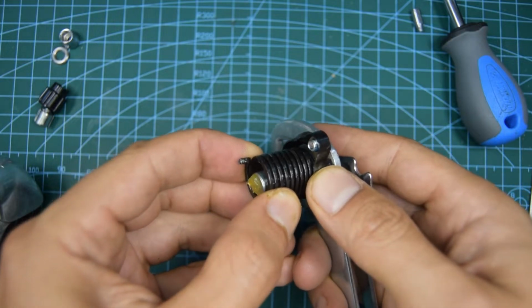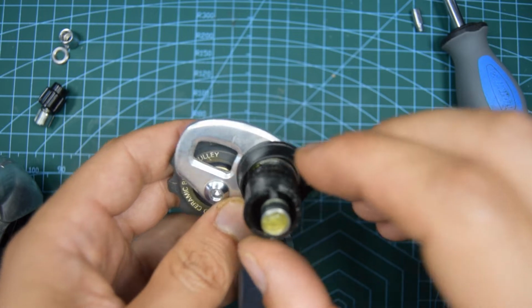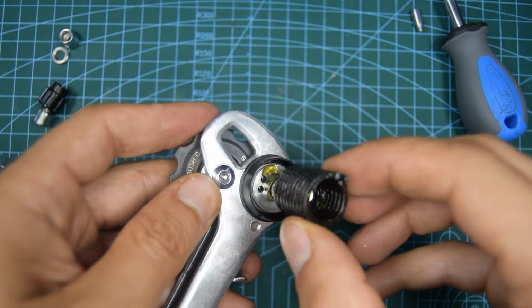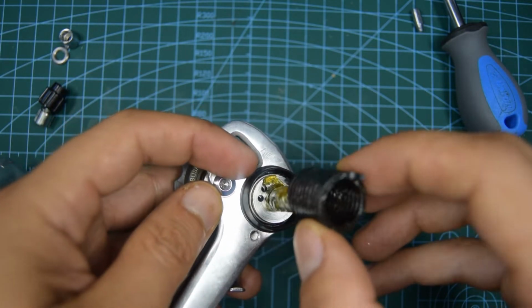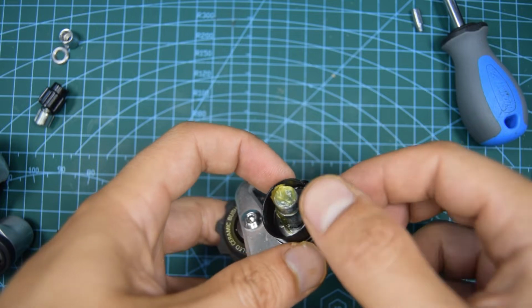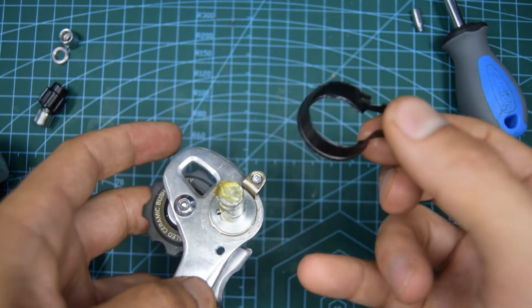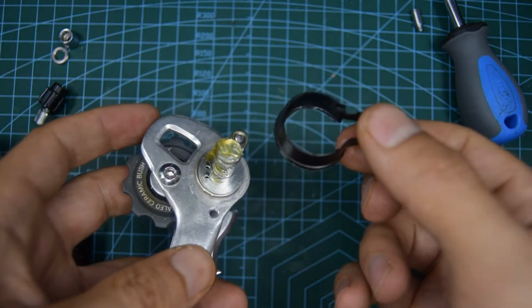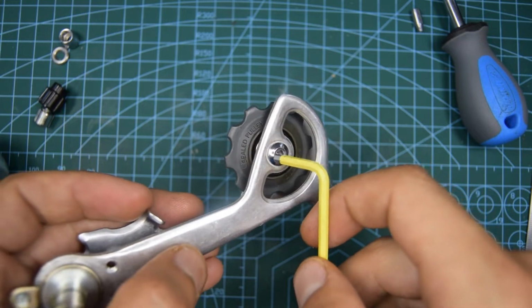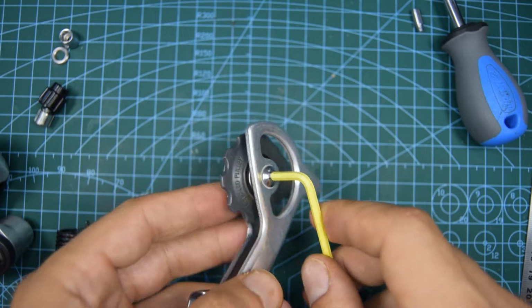You can now take the spring off here for the bottom knuckle. So the other tip of that spring was on the right hand hole. You can remove this type of seal. These are very often broken on used XT M735s. Let's take off the jockey wheels. We'll take off the bolts using a number 3 Allen key.